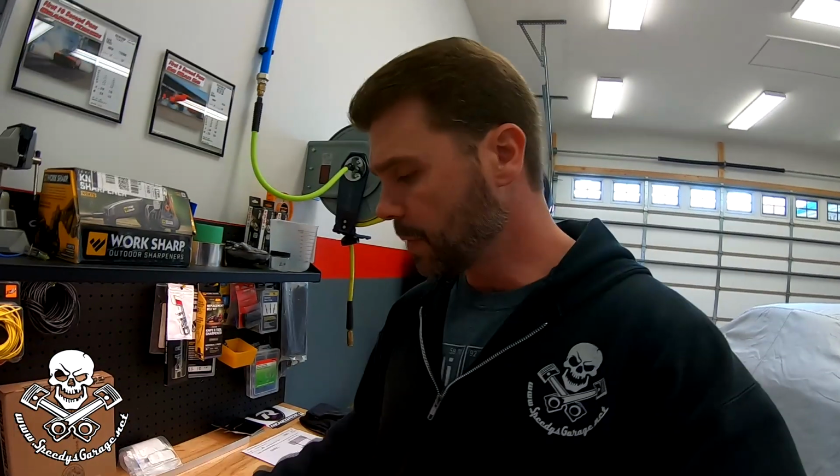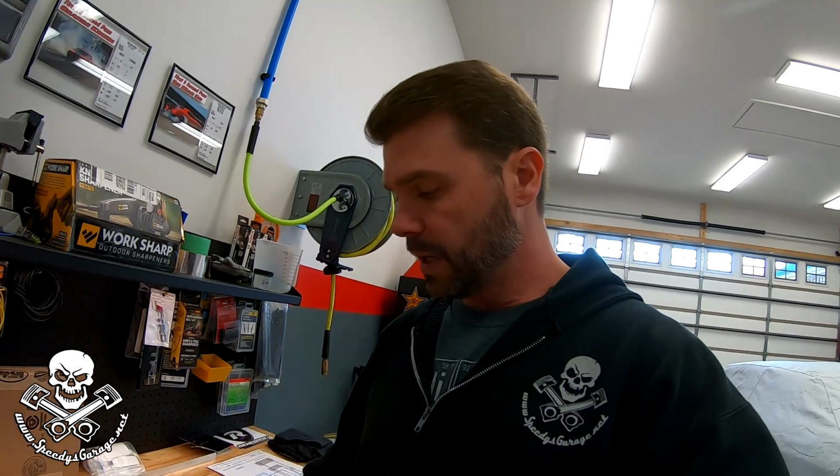And I think what happens is, because this is aluminum and this is steel, and you have electricity basically running through this aluminum into the steel, because that's how the bulb grounds, you end up, and water can get in there. So we're going to probably do 2 or 3 things. We're going to try to find a way to maybe separate the backing plate a little bit from the housing, maybe a rubber washer, maybe some JB Weld or something on the back as a coating, or maybe some paint, I'm not sure.